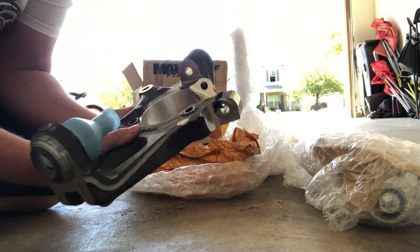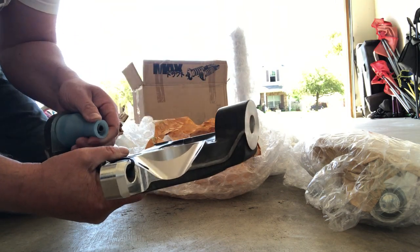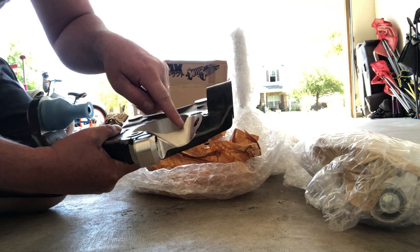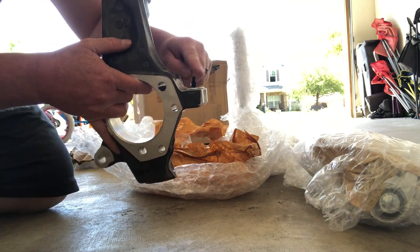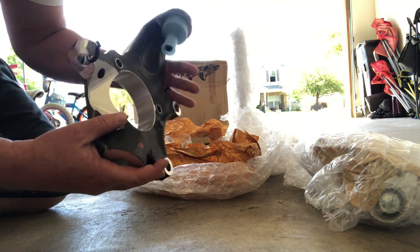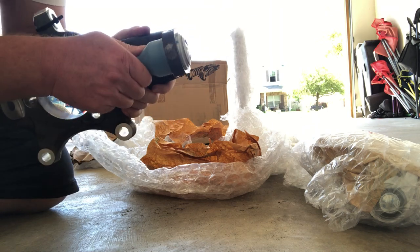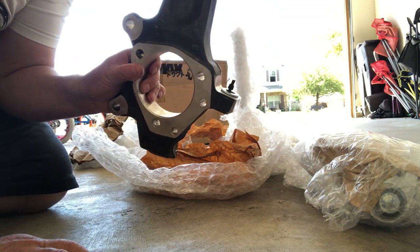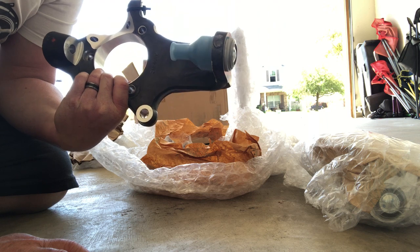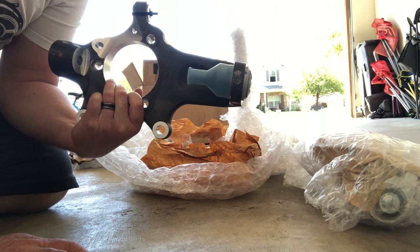So here's one of the knuckles. Any of y'all that knows anything about Corvettes — they come with very minimal stock steering angle. You can see here that they're gouged out and the pickup point is different from the stock knuckle. This is a stock knuckle that's been modified by PBM, so it's original GM with new ball joints. Their website says it's good for up to 70 degrees of angle — I guess we'll see about that when we do the install. I'm sure there's gonna be some more modifying to get that much; I'm expecting more like 50.